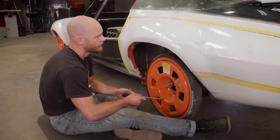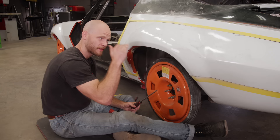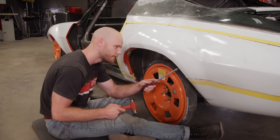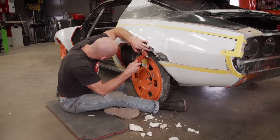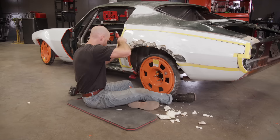So I have the quarter panel mostly cut out, but to fully release it I actually need to get to the corner of the stock wheel lip. Everywhere along here I need to grind so that the sheet metal releases, and to get to it, I need to get all this foam back off so I can get a grinder in there. I'm just going to take my screwdriver, shove it in here, hit it with a hammer, and try to crack it off. The reason why the foam was on here in the first place is because it was used to shape our fender flares, which gave us the plug to mold the carbon fiber quarter panels.